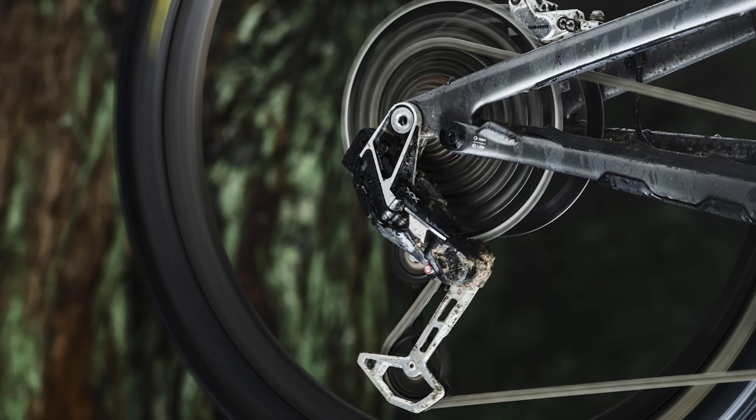The magic wheel is basically a pulley that allows the outer part of the wheel to keep turning even if something gets stuck in the inner part, like a stick or debris. On the Type-T mountain bike rear mech that SRAM released, it's on there. If you imagine the teeth as an outer ring that are separate from the inner pulley wheel that's got the bearings in it — if a stick gets in and seizes that inner wheel, the actual teeth will still rotate on the outer wheel, so your chain can still move forward and you're not going to snap your rear derailleur. So the pulley wheels have like a freewheel in them. Pretty much, yeah.